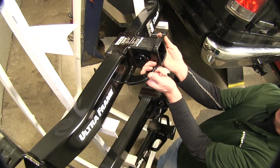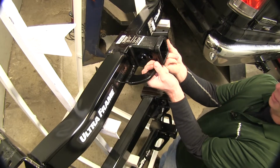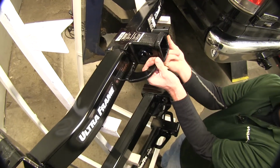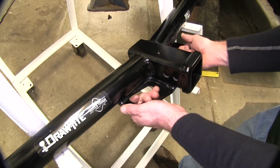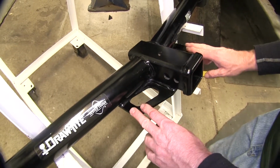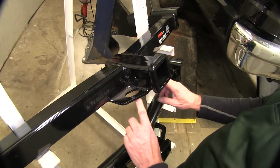Let's go ahead and take a look at the safety chain loops. If we look on our Ultra Frame here, this is part of a cast construction right here, and this will accommodate a very large variety of safety hooks. Now, Draw-Tite here carries the same theme with the wide holes on here, but does have a little bit less heavy-duty construction to it. And going back to our Curt hitch here, you'll notice it has a regular standard opening